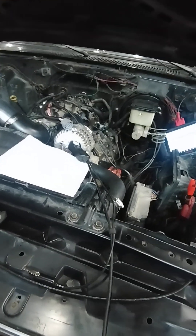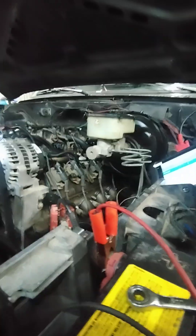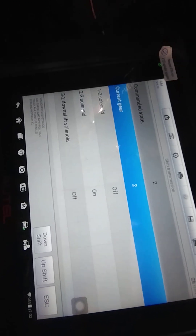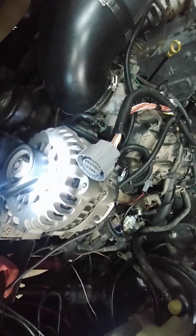It works fine but you can never get first gear. I'm checking the electrical part right now. I've got the scanner here so I can upshift and downshift to whatever gear I want. I've got the transmission plug pulled out so I can scan it easily.